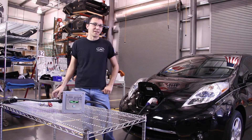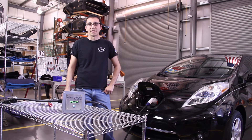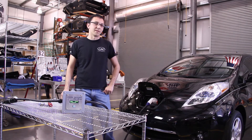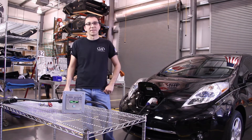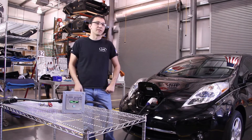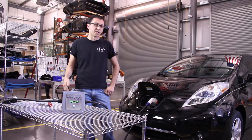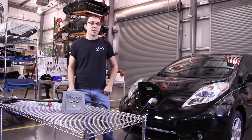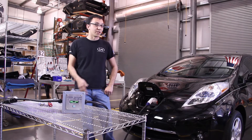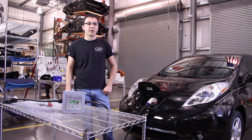It's also infinitely upgradable, so you can put different types of relays in there in the future and bump it all the way up to 80 amps — that's the highest of the SAE J1772 standard. The other cool thing about the standard is it's a standard, so you can charge a variety of different electric vehicles with it: anything from a Tesla Model S with the adapter, a RAV4 EV, or a Nissan LEAF. It's the most common standard, and that's why we chose to go with this one.